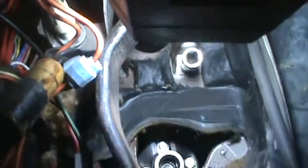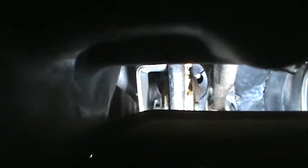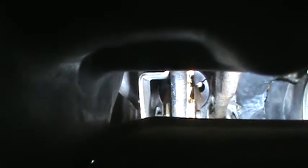I think maybe before that, I will try and take that clip. I think that's it right there that holds the brake pedal on. Kind of right in the center of the picture there, you've got to pry one end of it up and then slip it off. I think a long screwdriver is probably going to be what'll get that out for me. But I don't think I'm going to even try to video that. I'll show you how it works when I get it off, but trying to hold the camera and tools and everything is probably not going to work out.